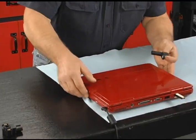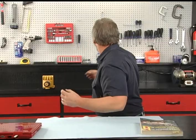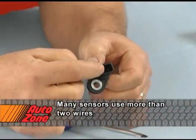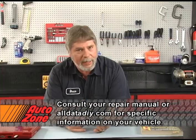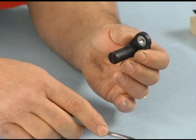If we have a bad camshaft sensor — here's one right here. It's really pretty basic. This is a magnetic sensor and the way this works is real simple. This is a two-wire sensor — there are two wires to the sensor itself. There's a trigger wheel on the camshaft; it could be on a camshaft gear or on the camshaft itself. As that reluctor comes around, it breaks the magnetic field, and that input is sent to the computer so the computer knows where the camshaft is.